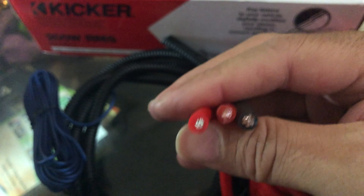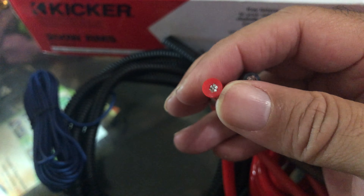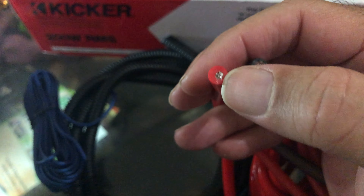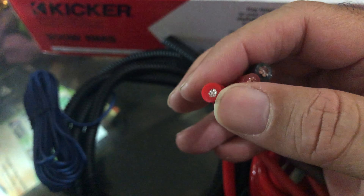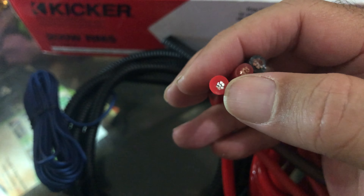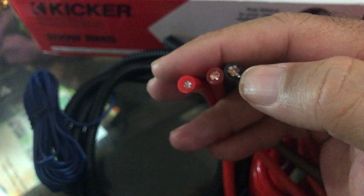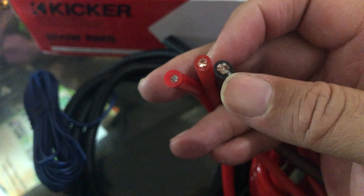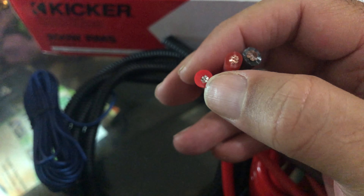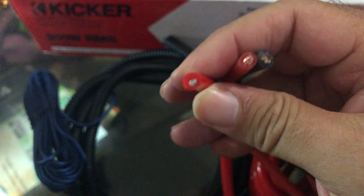Just a warning for you guys — keep in mind, what's also disappointing is the fuse that came with this kit was an 80-amp fuse. You've got an 80-amp fuse on wiring that can't even transmit — I'm guessing it won't even get 50 amps before it melts. So it will have no actual protection in your vehicle. The fuse holder it came with was actually really nice, so what I did was change out the fuse to a 40-amp fuse — probably the correct fuse for what I'm pulling. The JL Audio actually has a 30-amp fuse built into it, and the fuse is right next to the battery within 12 inches, so I shouldn't have any problem. But if I had the original 80-amp fuse in there, this wire could literally melt in a cabin fire before that fuse ever tripped.